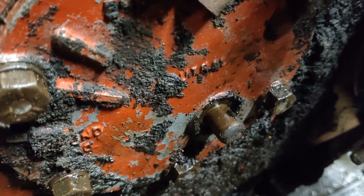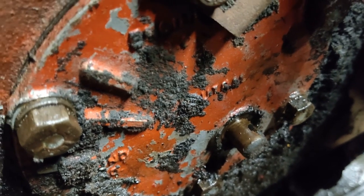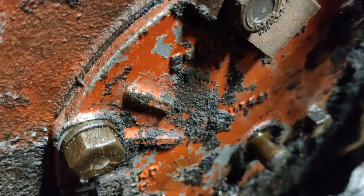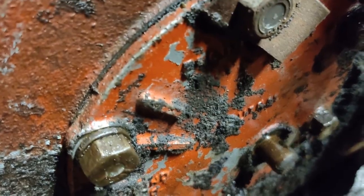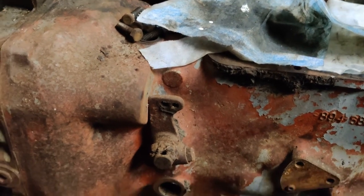We've got that little bundle of joy there rendering both the clutch cross shaft and that lever worthless. The pin holding the PTO lever onto that shaft had been replaced by a quarter-inch bolt which was nice and sloppy — so how they ever managed to engage the PTO into gear I don't know, because there was enough play on it. On this side again more of the same — it's leaking oil out of the seal there, leaking oil out of everything.